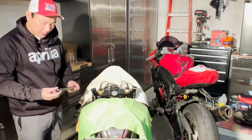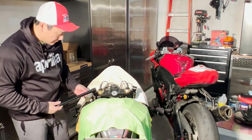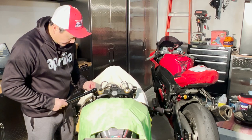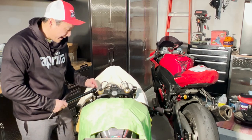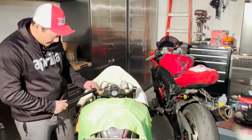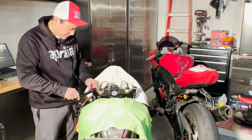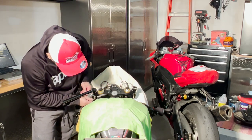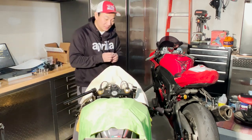Next I'm going to install the handlebar. There's a little kink — the sweep angle — I'll put it at zero and just a tad over. There isn't much length to protrude through, and you don't want that because you don't want to interfere with the suspension electronics. Using the middle marker I'll set it at zero and tighten the screw to keep it in place. Be careful with the bolts — a reminder to myself not to strip them.